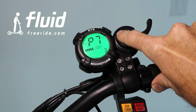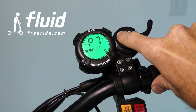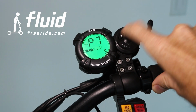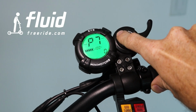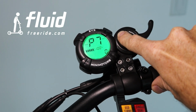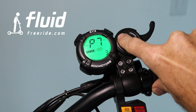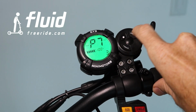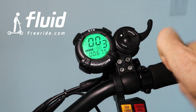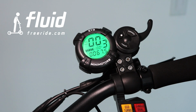If you set this to 3 or to 4 or even to 5, which is the maximum slow start setting, that ultimately means that you'll pull the accelerator and you don't have the full torque of the scooter right from the start. And I think this makes sense, especially in the beginning, to kind of put this to 3 or so, because ultimately, if you've seen my other video, if you pull the accelerator and you're not really careful when you're in dual motor mode and turbo mode, you ultimately will feel that the front wheels are spinning a little bit and it kind of pushes you back.